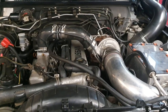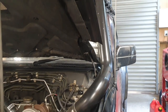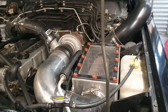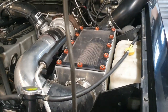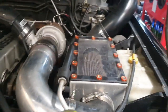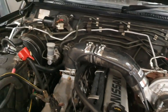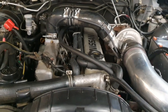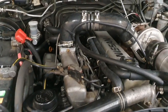Let's have a look at it. You might recognise this one — this is the one we put the snorkel on earlier on, which again wasn't really a kit. It was a kit using the term very loosely. The air box and stuff weren't designed specifically to go into this vehicle as a bolt right up, but we got that done. Air filter's looking a little squishy in there. Never mind. So cold air goes in, into the compressor, increases pressure and temperature and comes out hot. At the moment it just goes into the motor hot. No issue with detonation being a diesel, but colder is better — air density, science and stuff. Colder, more power, more broom will go.